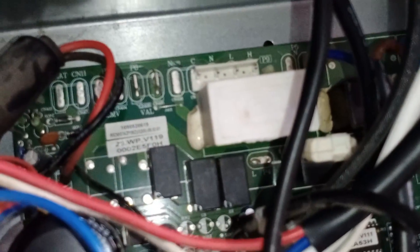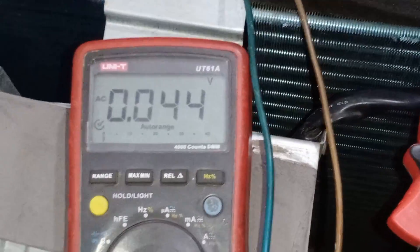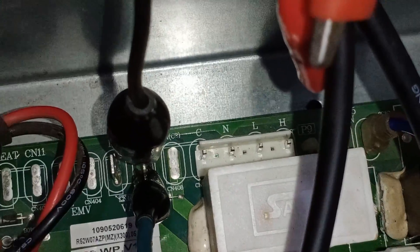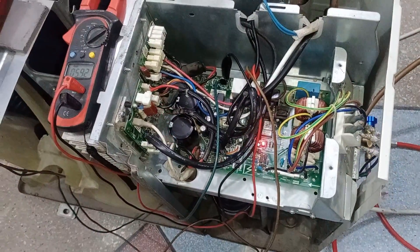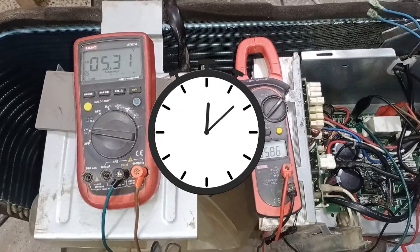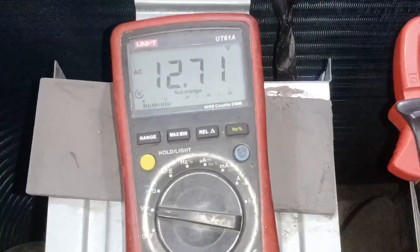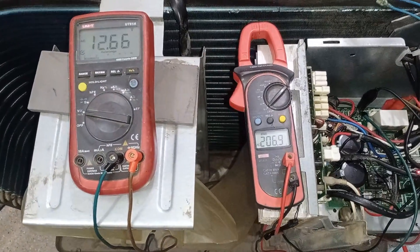I have replaced the capacitor with a new one, but the problem is the same. I will now test it further. I have taken two multimeters set to AC voltage, with the black probes attached to the neutral pin. The two red probes are placed one on the high pin and the other on the low pin of the connector to check if electricity is passing through simultaneously. After waiting almost three minutes, electricity is first passing through the high pin — almost 212 volts — and 12 volts are shown on the other multimeter, which means the relays are fine. The compressor has also started to work, so it is confirmed the circuit board is absolutely fine.